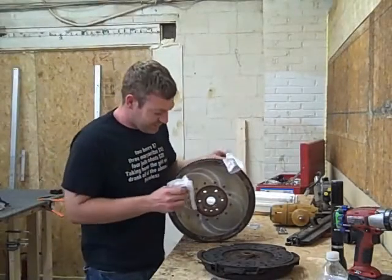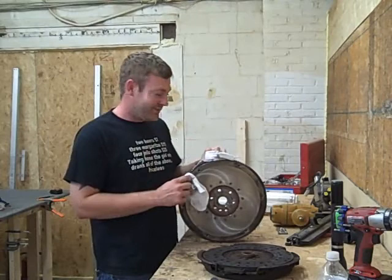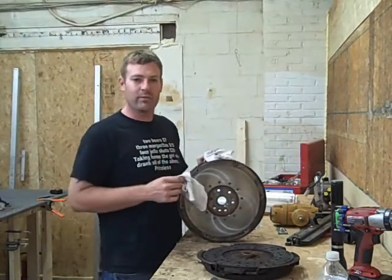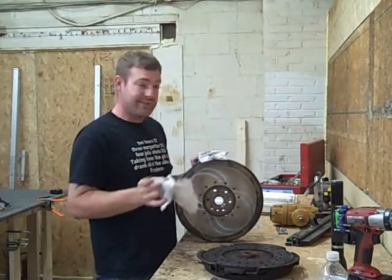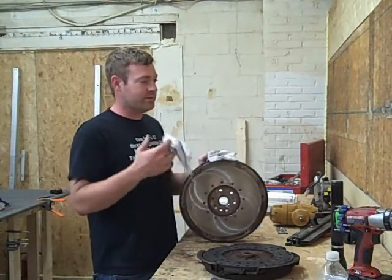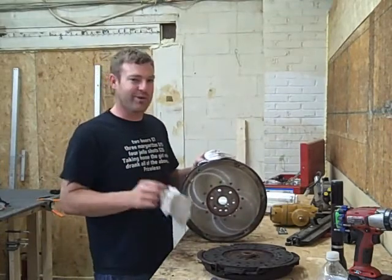Here's the flywheel from the first part of the video, back out of the truck. The whole reason I went in there to replace the clutch was because of the idle — it had a knocking sound, and when I turned the truck off it sounded horrible. Diesels kind of come to an abrupt stop, but this was just bad. It was embarrassing, everybody around you would urge you to turn your truck off.